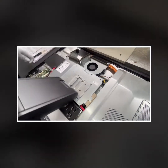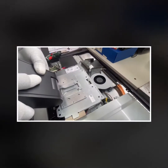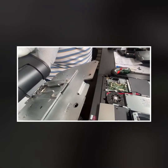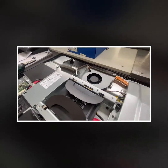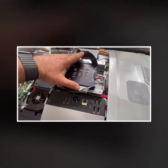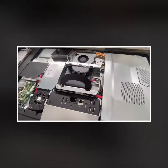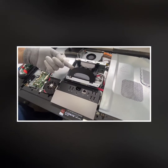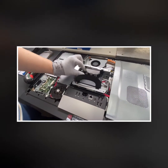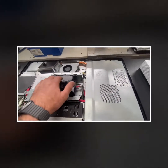So you open those, then lift that panel up and slide it toward the front. You see, there's a lip that goes underneath there. We've already upgraded this one — if you're installing an SSD, you need a special caddy, otherwise it doesn't fit in there.